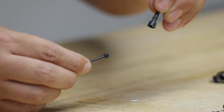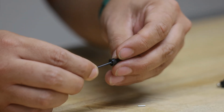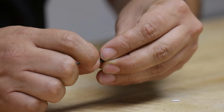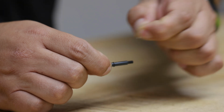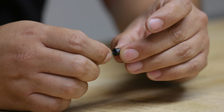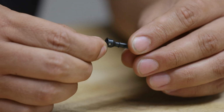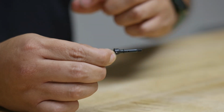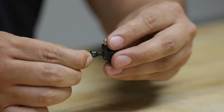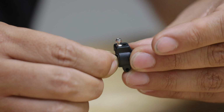and then there's a hole on this drive. You line all those holes up, and then you slide your pin in. So what I like to do is hold this entire assembly, grab my pin, and then work it in. Now it's not that hard, as you can see. That went in pretty smoothly. The key thing is keeping that level to keep it from falling out, and that pin is captured by the bearing itself. So now this slides in, gets captured by that bearing.